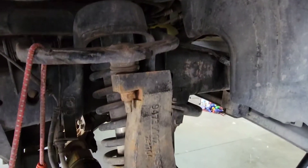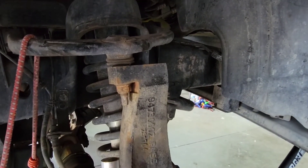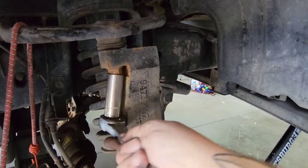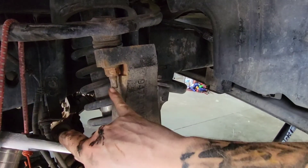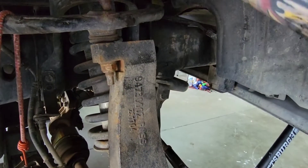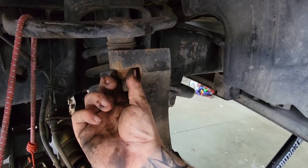Now we go up to the upper ball joint — this one is 13/16ths. Because of the lift kit I have a much different spindle, so it's really difficult to get a socket in there. I already loosened this with a regular open-end wrench. Normally you can get a socket in, but the shaft here is too long for a shallow socket. If the whole thing is spinning, just put another small wrench on the bottom to hold it still while you twist the nut off.